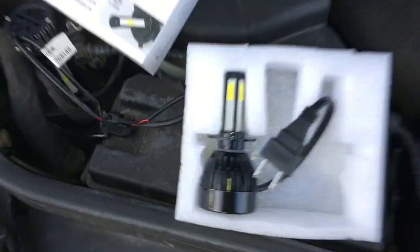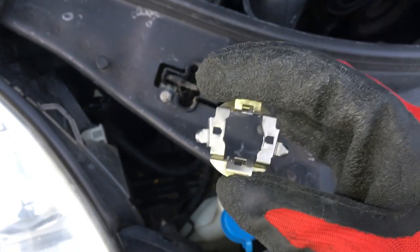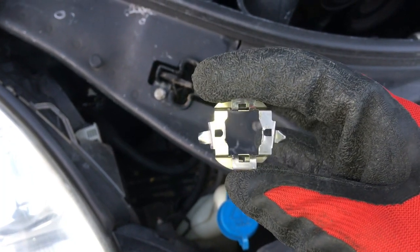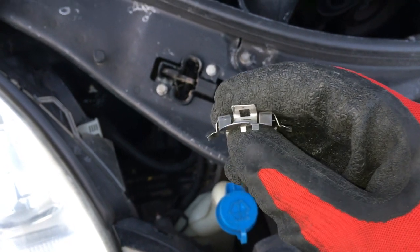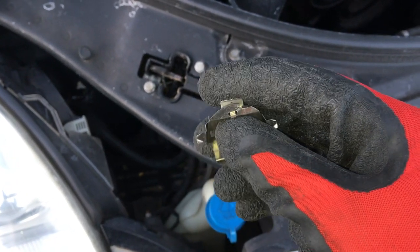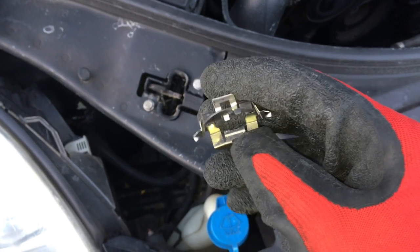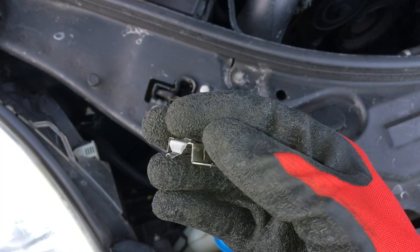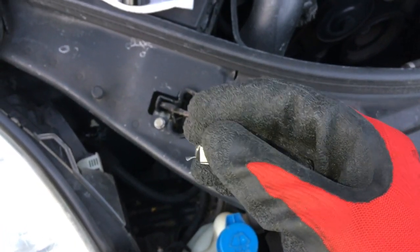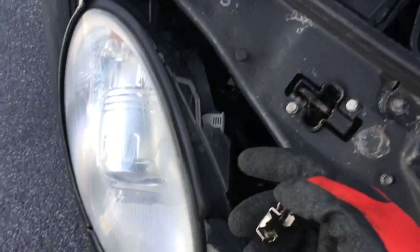This is how I modified the adapter. I enlarged the center a little bit. You also have to bend the little tabs — the one in the middle, this one, and the one on the bottom — bend them in. Then bend these ears out, because they're the ones that twist into the ears inside the headlight.